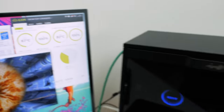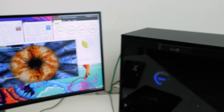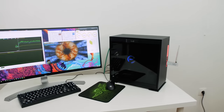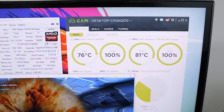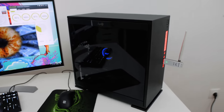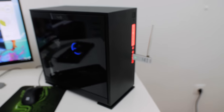The fans here are maxing out — at full speed because the temperature really went up high. This is your best case scenario. Now I want to put the fans into their more normal profile — like the silent curve and my custom profile curve — so that they still do a very good job but they're not super loud, because right now the machine is not exactly silent. Here are the temperatures on the quieter profile: the CPU hovering around 75 to 76, and the GPU dropped a degree. I'm not sure why — maybe it's because the circulation of air is better when there's less airflow coming from the front, not as turbulent or something. But the system is much quieter. What do you guys think of these temperatures? It's a little hot — 5 to 10 degrees, maybe more even — as the delta from such a restrictive intake.